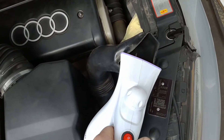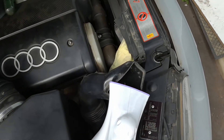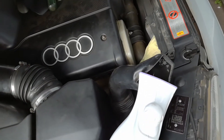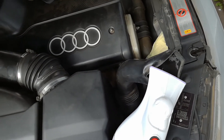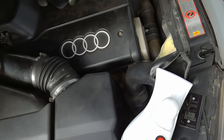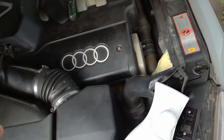I'm directing it into the intake manifold, into the air intake, as the car is idling. What that does is it's going to dissolve the carbon that's built up in the motor — really it's going to soften it so it'll end up getting blown out the exhaust.